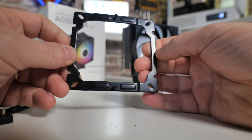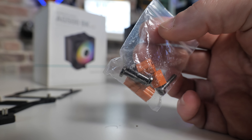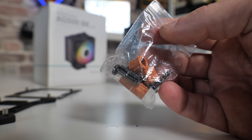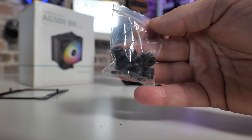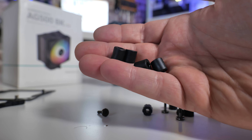You also get your mounting kits. The AM5/AM4 kit has four screws and orange fluted plastic risers. On AM5 on my MSI motherboard, pushing these over did require a little bit of extra force. On AM4 I found that one orientation of the plastic bits fitted easily while the other required a little extra pressure. On the Intel side there are small black spacers — completely rounded ones for LGA 1200 and 115X, and fluted ones for LGA 1700, with the same screws for each. Very simple and straightforward.